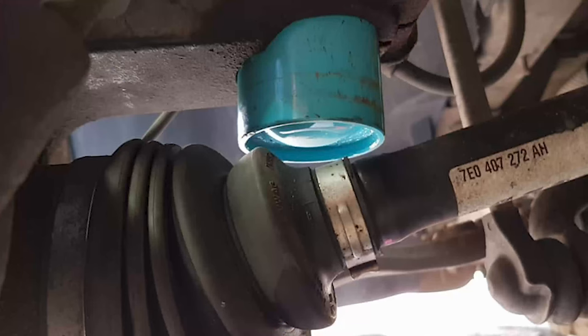There are some other things you can do when lowering. You can do what's called a hub mod — you can only do it on T28 and T30 spec vans, not T32 which has a different hub. Essentially you remove a restriction in the hub that allows you to drop the shock through, gaining you 25-30mm. Another option is a machined T6 top mount — a later model T6 top mount that's been machined, gaining you anywhere between 7 and 12mm.